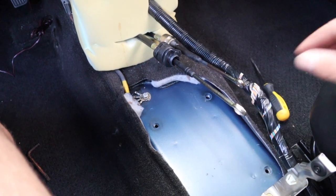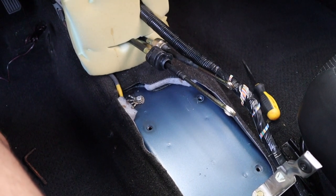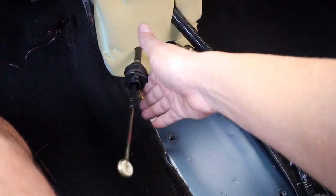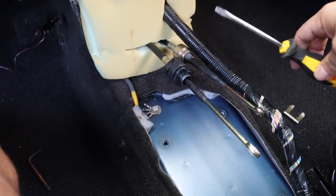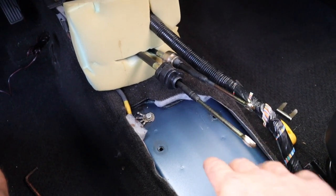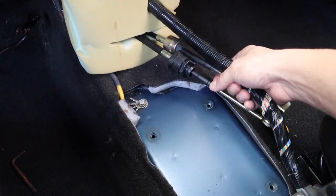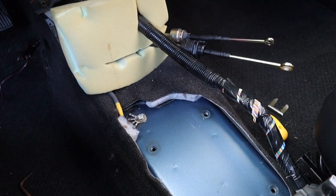The cables are hooked by a pin — pull that pin out, move the clips and cables to the side. Remember: one cable is twist-and-pull out, and the other you pop up the clip using a small flathead. So four screws, pop the cables out, and it should come out — it's that easy. Give it a little cleanup, then we're going to slide in the new shifter after moving the cables to the side.